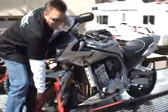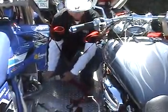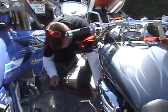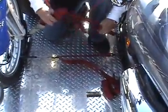Take a look at that. Now that we've got all four bikes loaded, you can see this particular trailer doesn't have a D-ring in the middle and the back. So we're going to improvise — take two straps and use the patent pending tabs to run a strap between the two chocks to hold them nice and together. Then put one right up on the top bar and run it across to the other side. Tighten that up and this thing is not going anywhere. Now we are ready to roll.